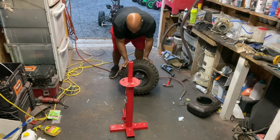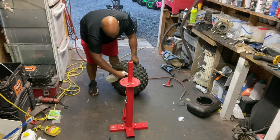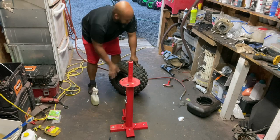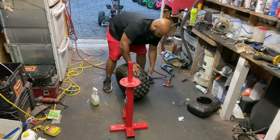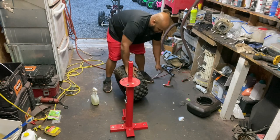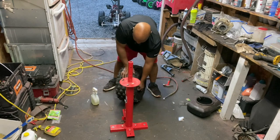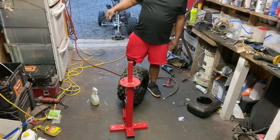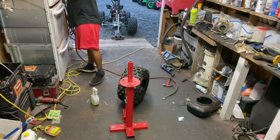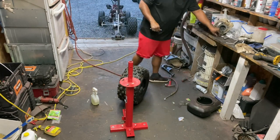Now let's go ahead and get that cap on there and give this a quick inspection. Upon looking around, I did see that my rim on the backside was not completely seated. So we're going to go ahead and pump a little bit more air in there, and with doing that it's going to seat the bead on the opposite side. We can let the air back out to make sure the tire is going to be even. I think we've officially put a patch on the inside of this tire as well as a tube and locked everything down as it should. Time to roll this outside and get it on the machine.